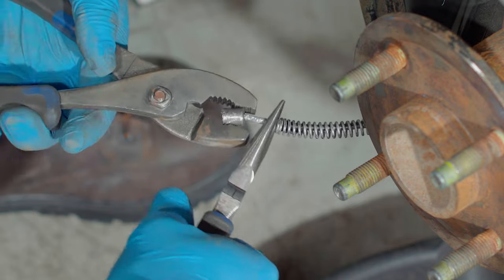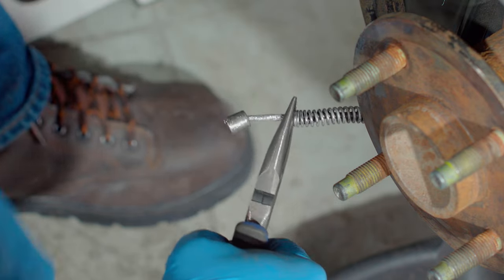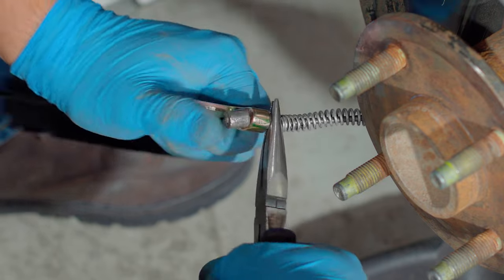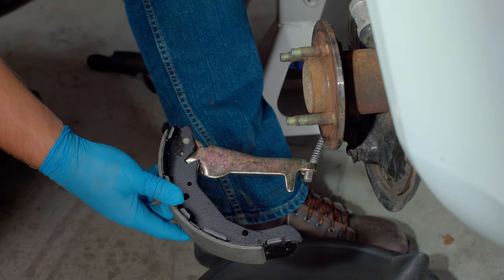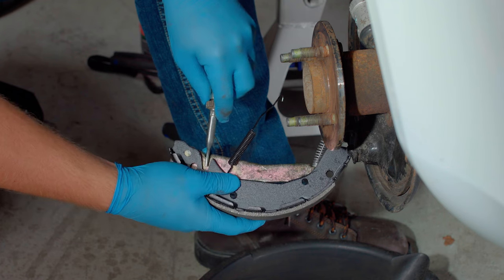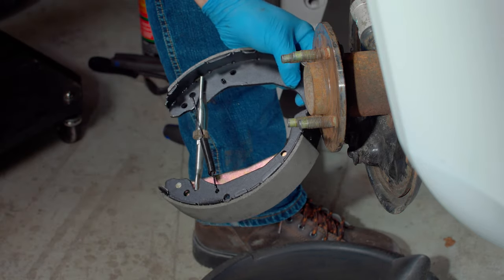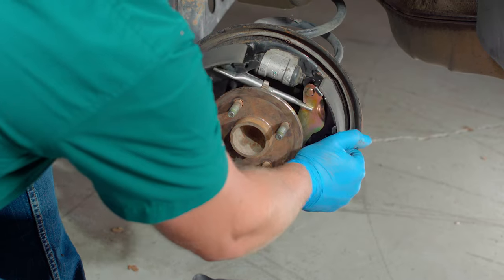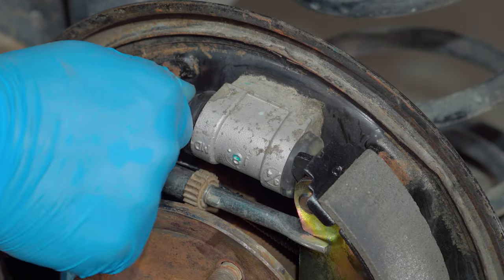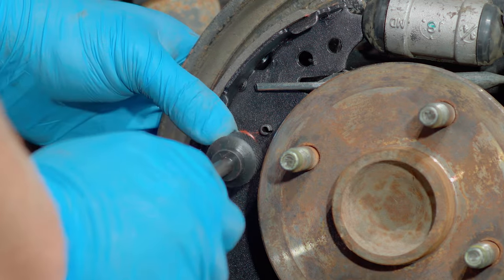The length of the brake friction material may vary slightly. Use pliers to pull down on the spring of the parking brake cable to attach it to the parking brake lever. If there is rust present, check the parking brake cable to make sure it is working freely before starting assembly and replace the cable if necessary. Due to the spring behind the star adjuster on this vehicle, it's easier to start with the shoes away from the backing plate near the axle hub. Install the star adjuster between the left brake shoe and the right emergency brake lever. Install the springs between the two shoes behind the star adjuster. Slide both shoes into place against the backing plate. Replace the brake shoe retaining pin on both brake shoes, turning it 90 degrees to secure it.